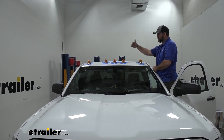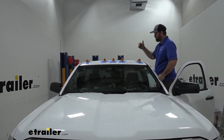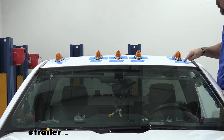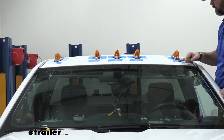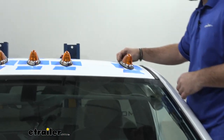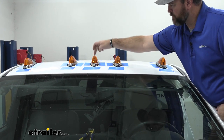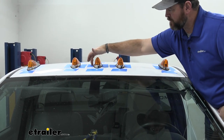Next, set your lights up on your roof and adjust them how you want. You can see how we have our three center ones a little bit closer. I put my center one in and centered it with the black mark on the windshield. For the two outside ones, I measured from the edge over, put a piece of tape on both sides, and measured from the edge up — tape in the front and tape in the back. Once I adjusted the light to where it was facing correctly, I put a black mark on the tape on the front and back, so if it gets moved at all, I can center it back up. Stand back, make sure it's centered, tape on each edge, then mark it.